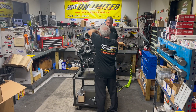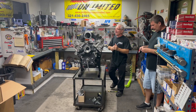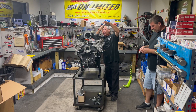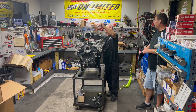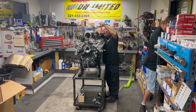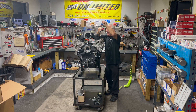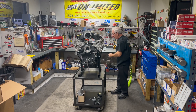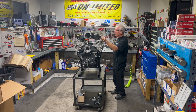You know what's funny when you get parts in — a lot of stuff comes in that people don't understand. To be a great builder is one thing, but it's about catching the pieces that come in that are defective. Part quality has gone way downhill. How many people would have caught that lifter with the clip being out of position the other day? Not many people — they'd have put it in, fired it up, the clip would have come out, and you'd have a disaster.